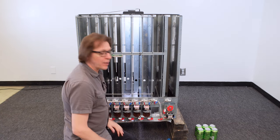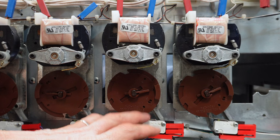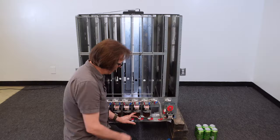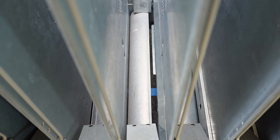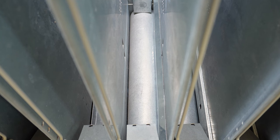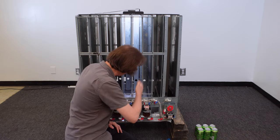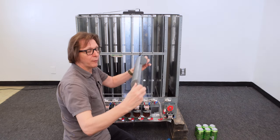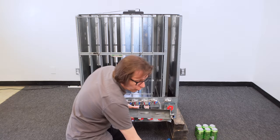Now I've brought the cradle back to where it was originally — using the same process, I press down on the cherry switch, lift up on the brake, and spin the armature clockwise until the cherry switch rides back into the notch. Now it's in its notch, so that's good to go. With the shim in and the cradle upside down, this makes it easier for me to reach underneath to put in the rod and spring.